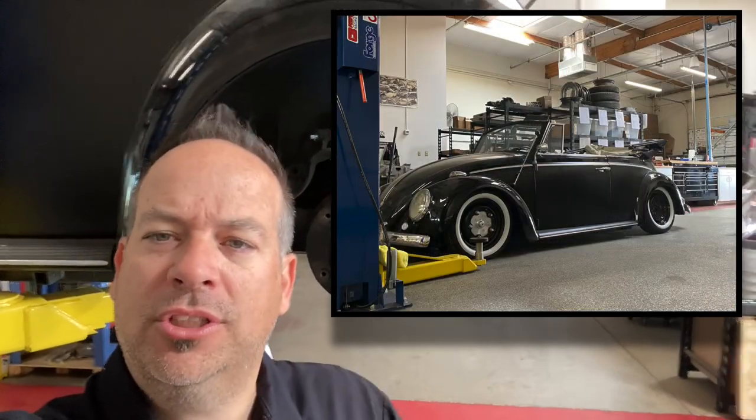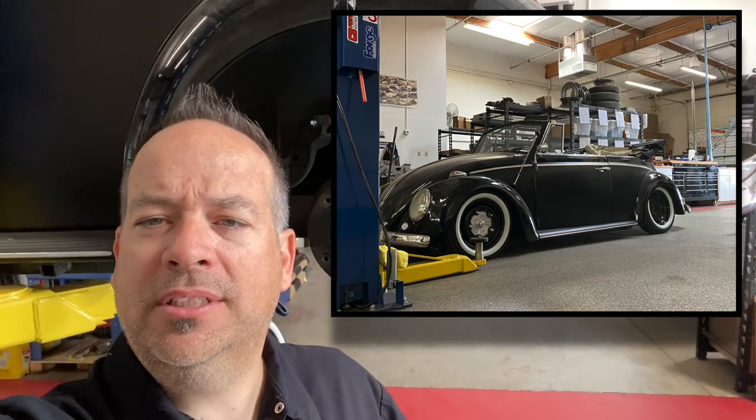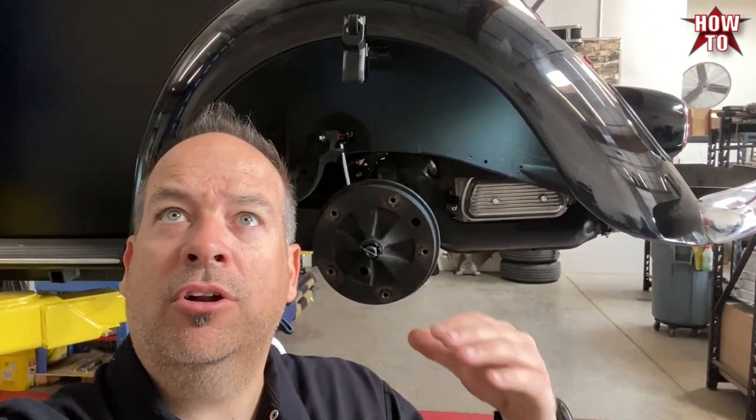What's up, Airkewld Army? It's your friend Pete. We're doing some fine tune adjustments. You're gonna come along. We set the car on the ground and the client says it's a little too low. So we're actually gonna go up. We did a measurement of the car to the ground and it was exactly the same left to right. So when we put it under load, it measured out as exactly the same. So we're gonna go exactly one spline down to raise the vehicle and put it all back together and make sure the customer, the client, the Airkewld Army likes the stance then. And we'll show you the process now.